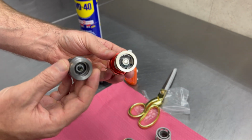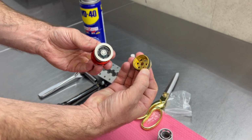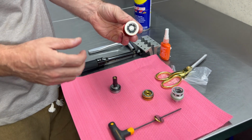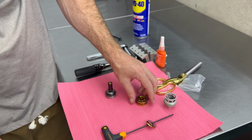Instead of providing you with this one, they're going to a 6-hole design. You can see that ours is pretty similar to what we're providing. So we're helping you turn your OEM shock to be more similar in terms of hardware and performance as the WP kit shocks. And also the Showa and KYBs, they have a very similar piston as well.